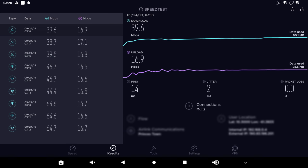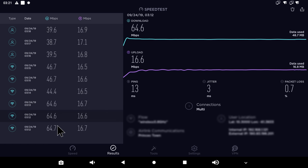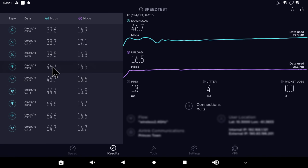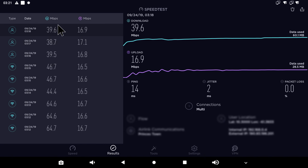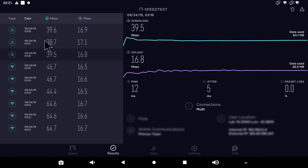Next, I have the results of the Wi-Fi and LAN speed test. The results are still the same for these models, where on my 60 MB package, the A95X F2 has maximum download speed only on the 5 GHz band. The 2.4 band fell slightly below the maximum speed by 28%. And the LAN port fell even further by 39%. The LAN port here is not as bad as the other models, but still a poor performance on the LAN port.